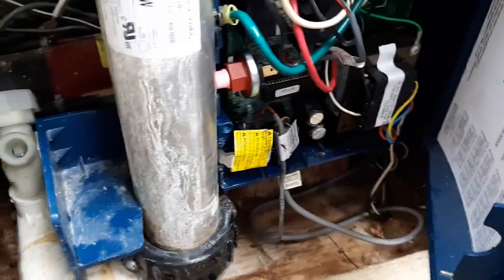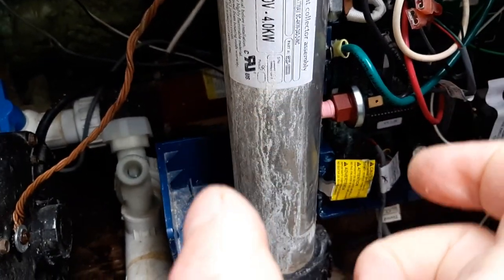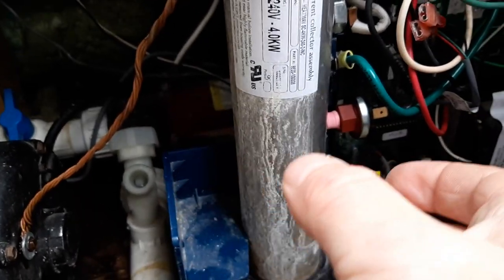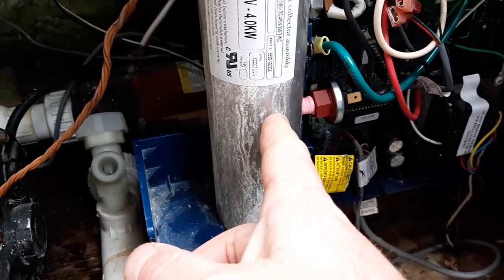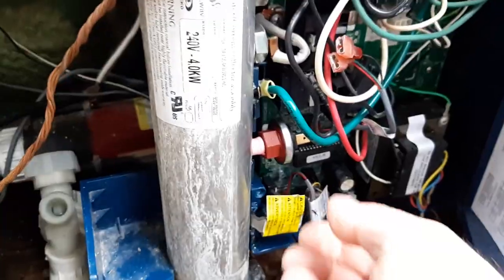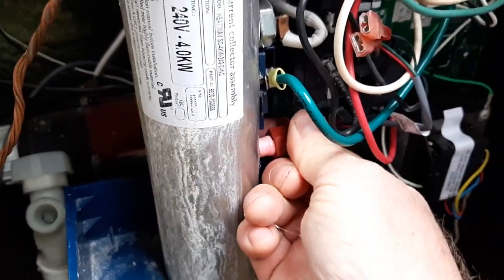The pressure switch sits dead center of the element, so the element will go on either side of it. Sometimes they're a bit off-kilter. It's happened a few times that if you put it in too deep and it's too close to the element, it will just melt the pressure switch — melt it closed. So we're just going to hand-tighten it really well and give it a little tweak.